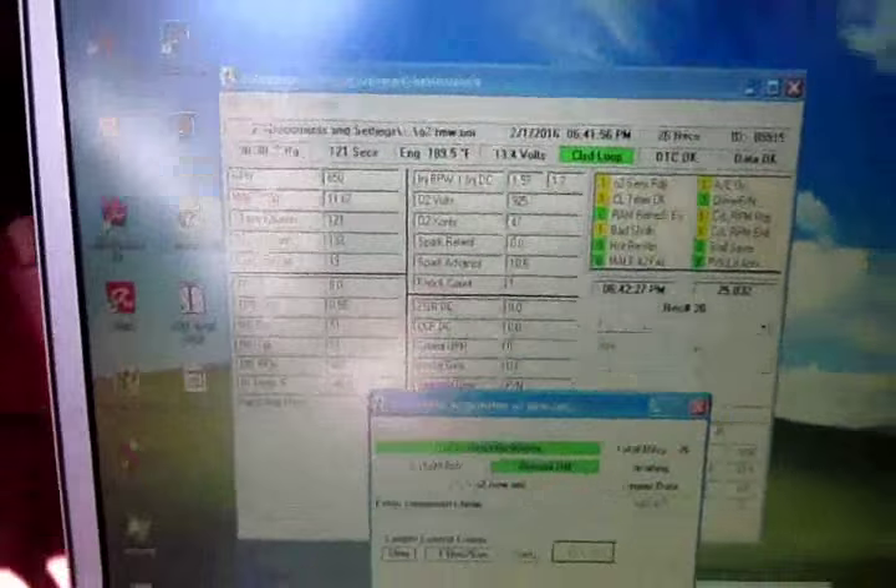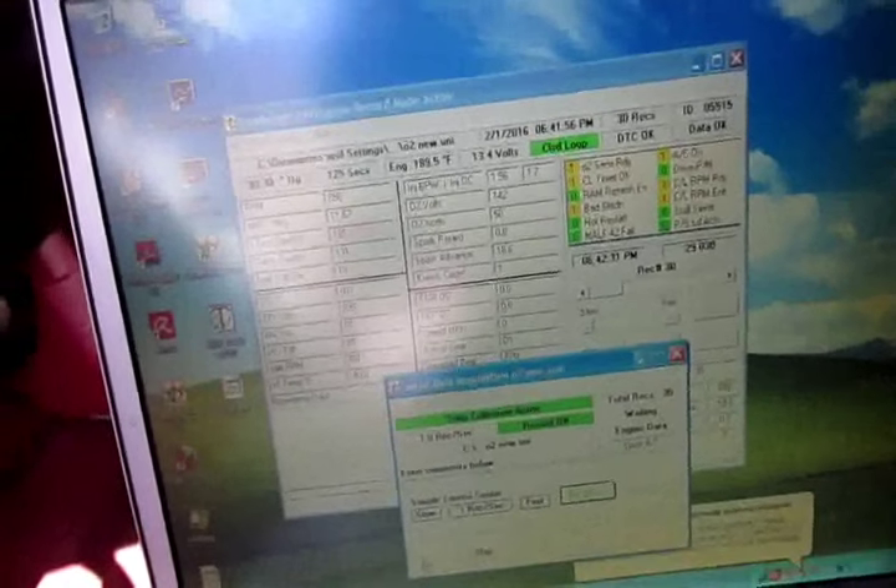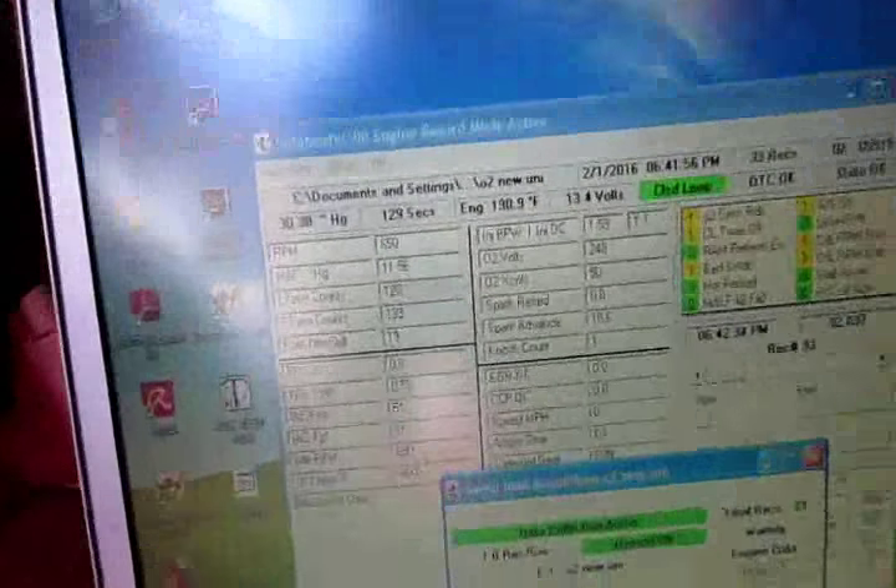She'll be good to go. Runs better already — yeah right — because I've reset the ECM. Pool people are going to start screaming now, going 'I came here to be quiet and this kid's got this truck out here changing O2 sensors.' This would cost you $300 at the shop and I did it for 40-something bucks. This is a three-wire heated sensor — heated means it gets hot, there's a little heating element. If you have one wire, it's not heated. Heated lasts longer than not heated. O2 is fluctuating, fuel counts are better — it's not pig rich.